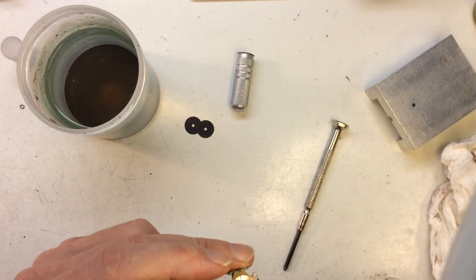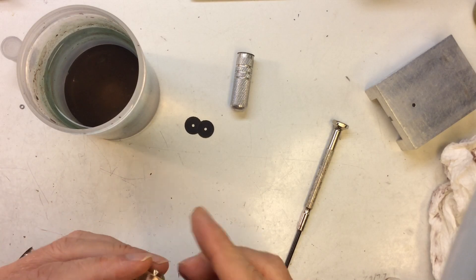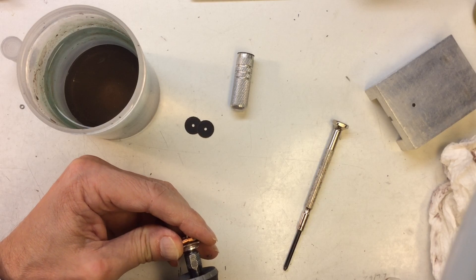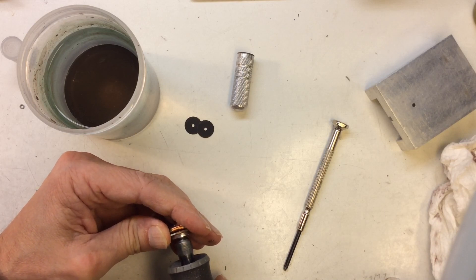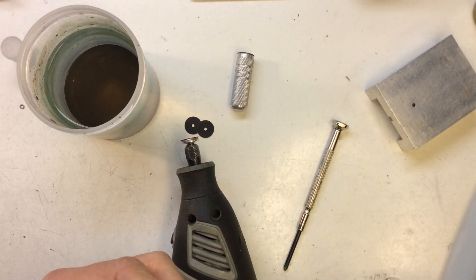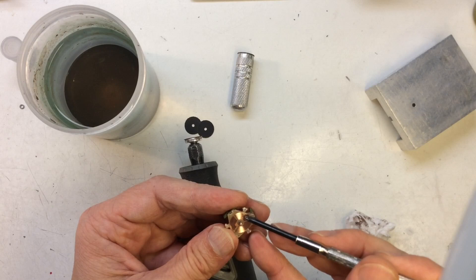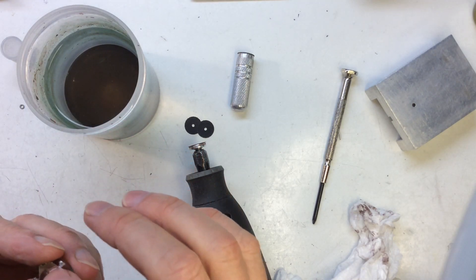This is kind of the other end of the spectrum — this one's pretty rough, so it's going to take a little time to sand it down. Hopefully I can get it done without burning all the way through the comm anywhere. A little more water on that with my finger. With more time it's getting pretty close. You can see there are a couple of spots here that still aren't quite through — still dull. So a little bit more work, if the switch will cooperate with me on my Dremel.